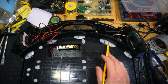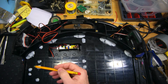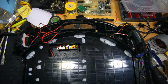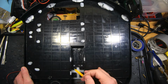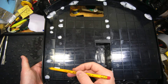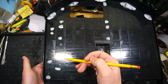On this side I also did the same thing with the reinforcement ribs. And of course I've covered all the holes and wooden screws with extra plastic to make sure that the waterproofing of this wheel will be of the greatest quality and will be really reliable. And the same story with extra plastic is in the pedal hangers area as it was on the other side, which I showed you before. And here is the location of the Bluetooth music board, which was moved from the main cooling system of the controller board to free extra space for an additional heatsink.